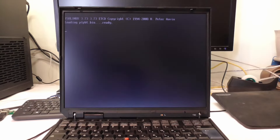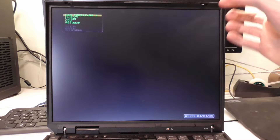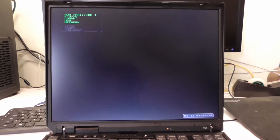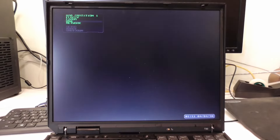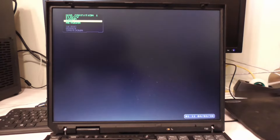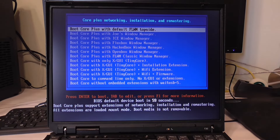I think it's called the PLOP boot manager, and it's very useful on systems like this that were just not able from the factory to boot from USB. So we go into the boot menu — F12 — it's already recognized the boot manager. We were worried for a bit since this optical drive is sounding not too healthy, but it works. We've got this Star Wars-like animation and we can now select floppy, CD-ROM, USB, or network. We'll try USB.